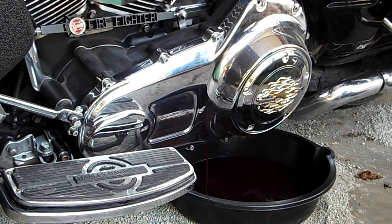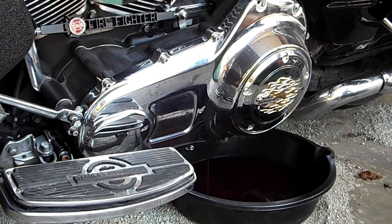I only wanted the springs. In fact, I only wanted one spring out of that set. So that showed up in the mail, and I'm taking it apart so I can take out the homemade concave spring steel washer that I put in there, the thin one that came out of the Screaming Eagle kit, and I'm going to replace it with one of the thicker ones that are made to go in this older style compensator, to see if I can permanently keep it from rattling and jostling around.